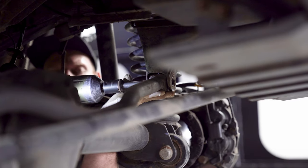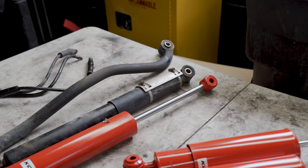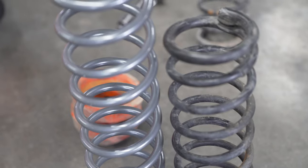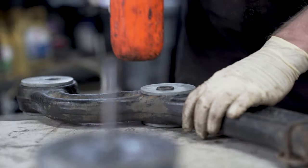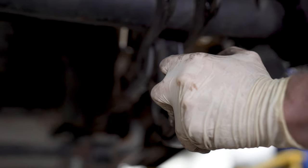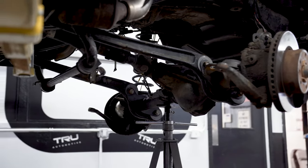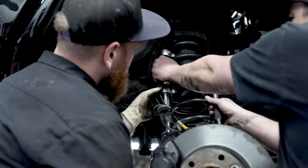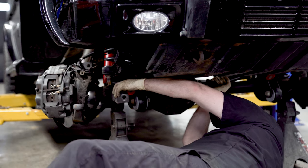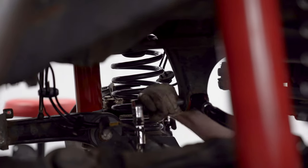After their chat, they couldn't wait to get their hands on one. Seeing them operate over two full days proved I was at the right place. The first few hours were spent understanding the suspension setup, which is actually pretty similar to an 80 Series Land Cruiser, and then removing all of the stock equipment. With a healthy bit of persuasion, the freshly assembled trailing arms go back on. Even with the axle at full droop, considerable compression is needed to stuff the new springs onto the perches, and then finesse comes next to get the spring compressors removed. Then the new shocks are mounted. When you increase a vehicle's suspension height, it moves the axle out of center — the adjustable panhard allows you to get the axle back to center with ease. Adjustment will happen at the end when the truck goes over to the alignment bay.